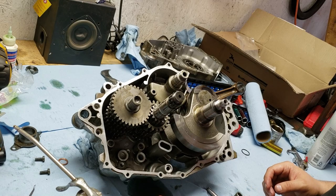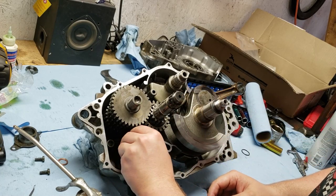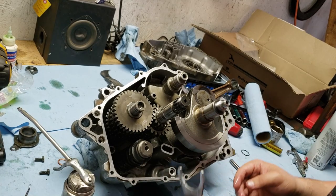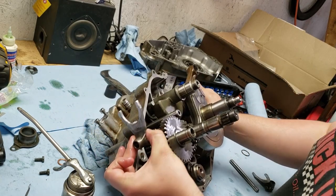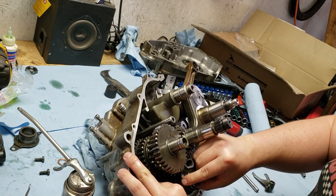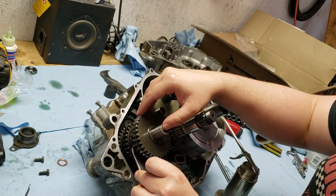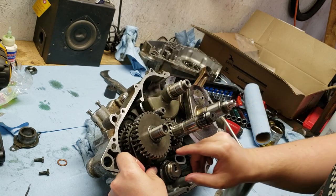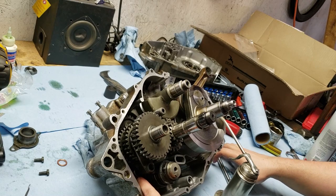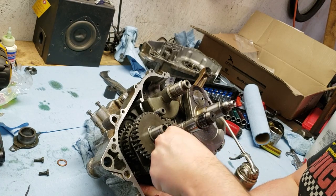Now we need to go ahead and put in the shift drum and the forks. The shift drum is first — make sure that the little dimpled part is facing towards you and put this end in. Go ahead and put that in there and make sure it spins freely. Then for the shaft, go ahead and lube it up. Next we need to install the shift fork labeled L. When you're looking inside the transmission you should see some grooves back in there — just slide the fork in and get it in the grooves. You may have to rotate the shift drum while doing this so it'll actually sit inside the grooves. Then grab the fork labeled R and install it in the second groove that's closer up here. I'm going to go ahead and put in the guide bar through both of them — I've already lubed this up and put a little bit of lube on the inside of the tube, and just slide that in the forks here, making sure it presses all the way in the bottom of the case.